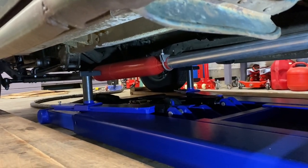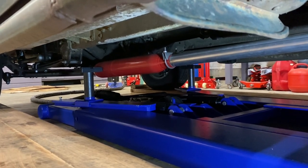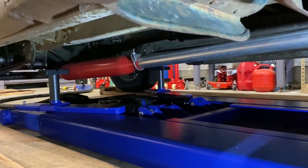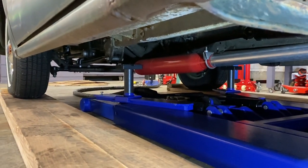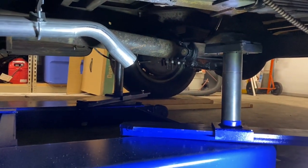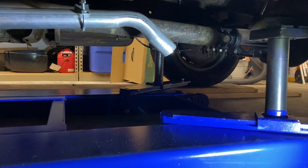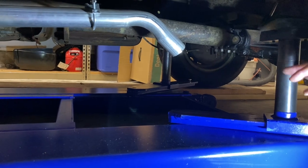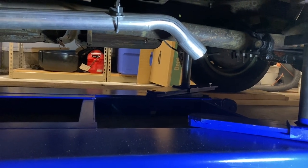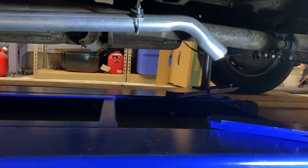Looking towards the front of the truck, right next to the custom exhaust, you can see the pad where it's going to meet the frame. On the passenger side you can see we've got the long extension, and here on the back on the driver's side it's going to come right up on the frame. We're using the long extension and the short extension because the front is contacting the frame first, so we want to make this lift level. Let me get back on my feet and we'll lift this thing up.